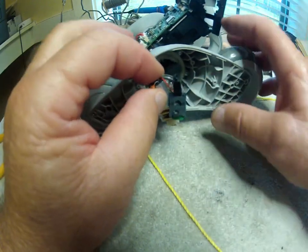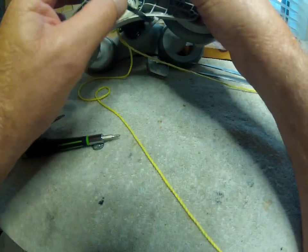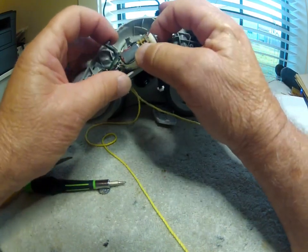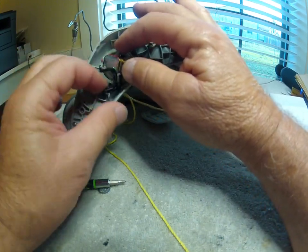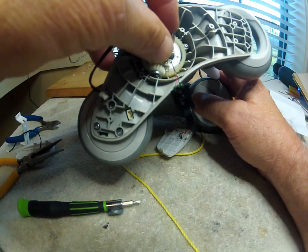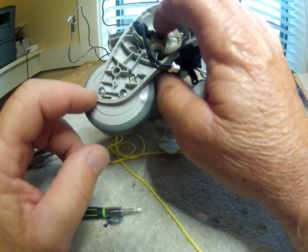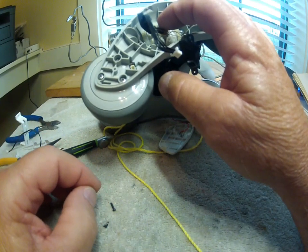Three shims, one washer — put it in place. Everything is secured. This motor mount has a tab: it will drop flat when positioned in the right place. Found that this guy locks flat with the tab in position — the sprocket going towards the drive wheel, facing down and back. Minimize any bind. I'm going to use my longer black screws to hold the plastic hip motor mount down.